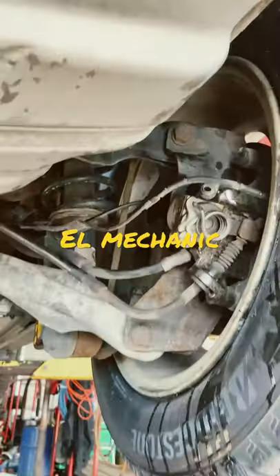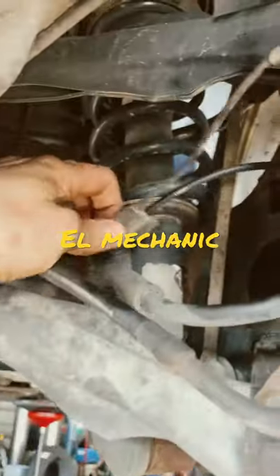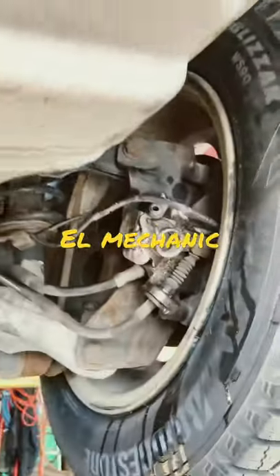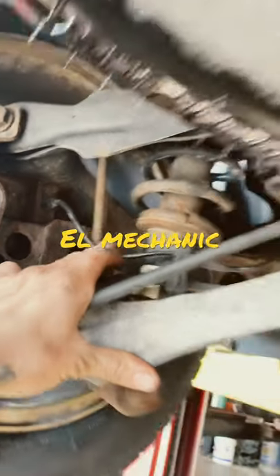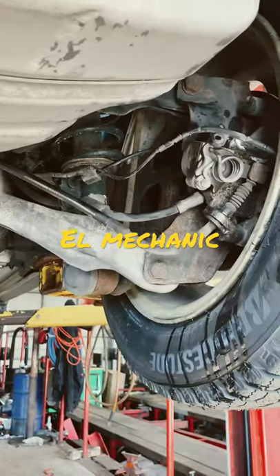Anywho, the video is about European cars with brake sensors. If you're gonna do brakes, you need to get new sensors each time, because the likelihood of them coming out is almost zero to none. If you notice, there's one over here but not one over here — that's the ABS, not the brake pad wear sensor. There's usually only one for both sides on each axle.